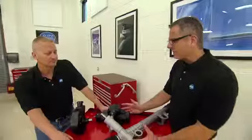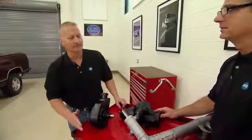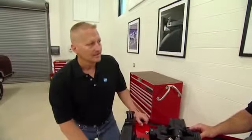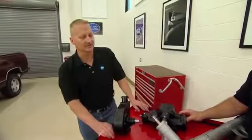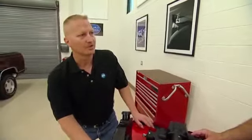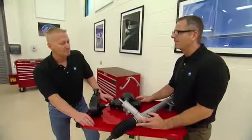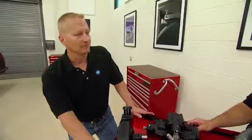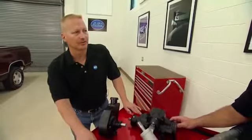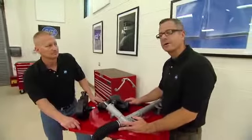That's for sure. There are so many fluids out there. Can I put any fluid in my system? Absolutely not. We recommend you always use the manufacturer's recommended fluid for that vehicle. Why is that? Manufacturers use specialized fluid, designed and engineered specifically for a vehicle to provide certain aspects to help in the flows and pressures for that vehicle so that it steers like it's supposed to. And how often should I service it with new fluid? We recommend every 50,000 miles, or anytime you change a component out, you flush and change the fluid. While you're doing that, it's important to put an inline filter in there, or change it if there's already one in there, so it keeps the fluid fresh and operates as it's supposed to. Thank you. You heard it from the engineer. Keeping the system maintained is key.